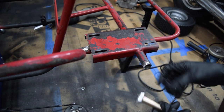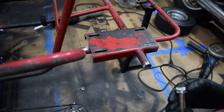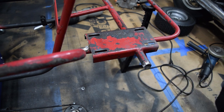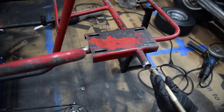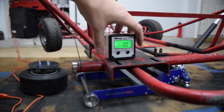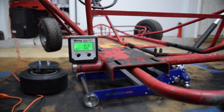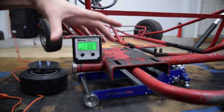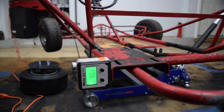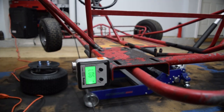I think this should be good enough. I got all the mating surfaces cleaned up and chamfered the pipe. I'm going to have to grind this lower portion down a little bit and then keep messing with it until the angle is the same, and then I can weld it. Checking the angle finder it's reading about 89-90 degrees which is right where it should be — within about 0.2 to 0.3 degrees — so given room for error that's essentially the same.